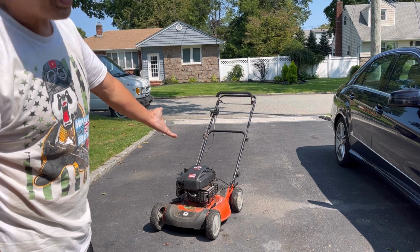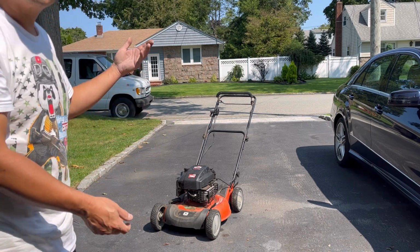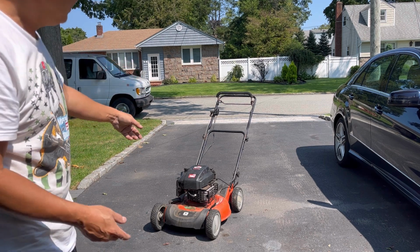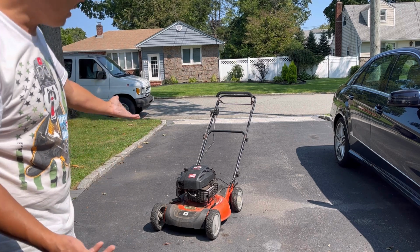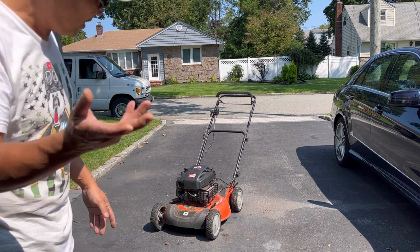Put the blade back on again. The cables were actually good. I thought they were bad, but they seemed to move. The engagement one, the propulsion speed control works, and I looked at the bale handle flywheel kill cable, and it worked. I put it on, pulled it like 3 or 4 times without even priming it, started right up, everything works. I'll show you.